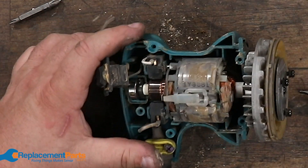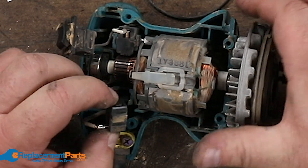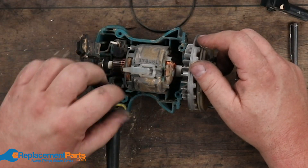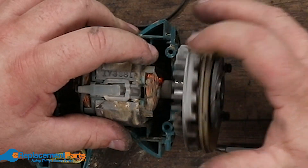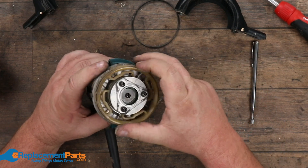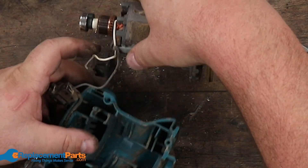You've got your brushes — and again those look like they just slide out. Of course the brush is on the spring, so we're going to let the spring out. Same — there's the brush on the other side. In the middle we have of course our electric motor. Our bearing down at the end, and then the orbital portion down here was just going to pop right out. Of course it's still going to be wired. Your armature, which is your main shaft that goes through, will actually just slide out.